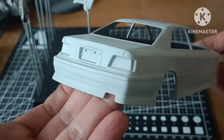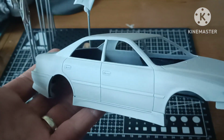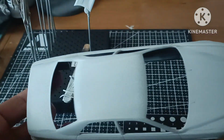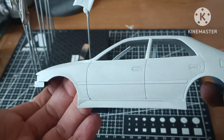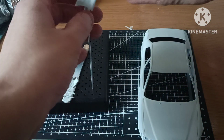And then here, we did give the body a very light wet sand. I think it was with an 800 sanding sponge, just to give it a light wet sand before applying the first stage of the 2-stage colour process. It didn't really need a sanding because it was smooth enough, but I'll just give it a sand anyway.